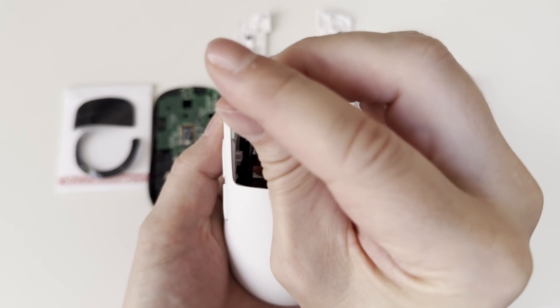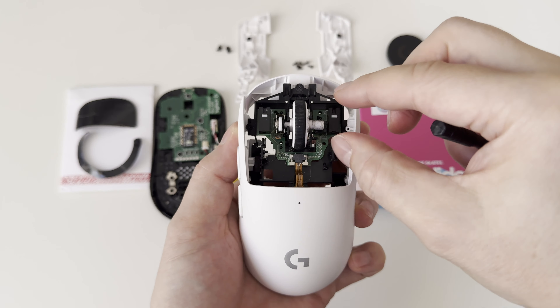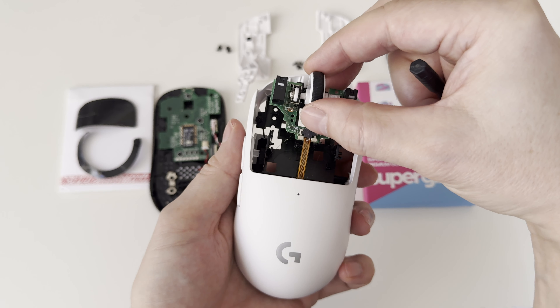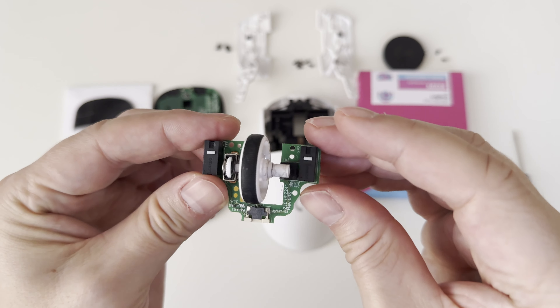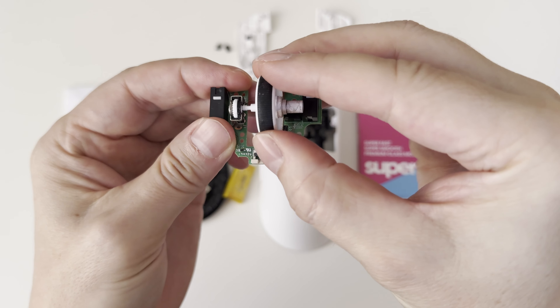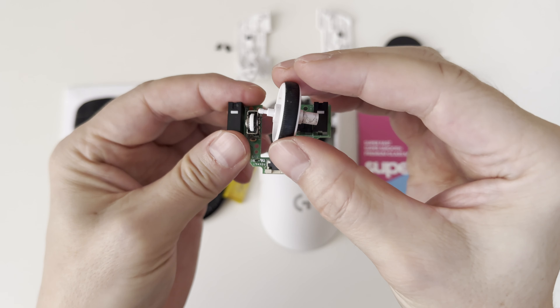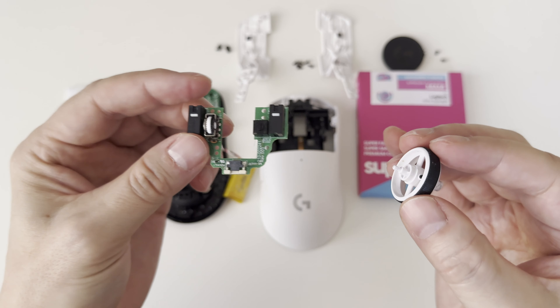I will unclip the connector and I am not going to remove the cable for now as it will slide out itself while I remove the switches board from the shell. Let me loosen those four screws holding the switches board on the shell cover, and I can slowly remove the switches board including the scroll wheel. There is a very small metal torsion spring holding the right side of the scroll wheel, so make sure you do not lose it as we will need it when installing the upgraded board. Now I can remove the scroll wheel from the scroll wheel encoder by sliding it out, and we can say goodbye to the old switches board with Omron 10M switches and the TTC white/silver scroll wheel encoder.